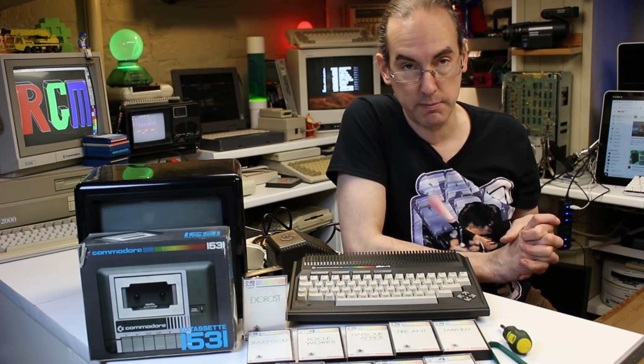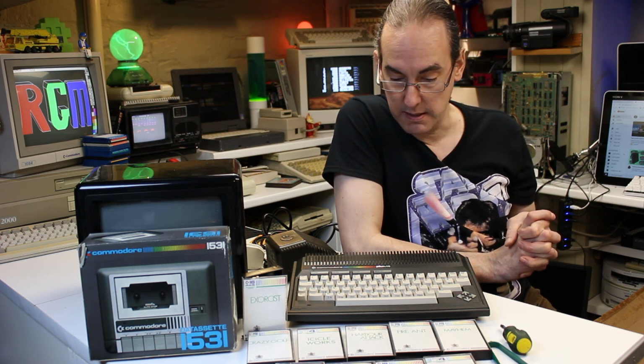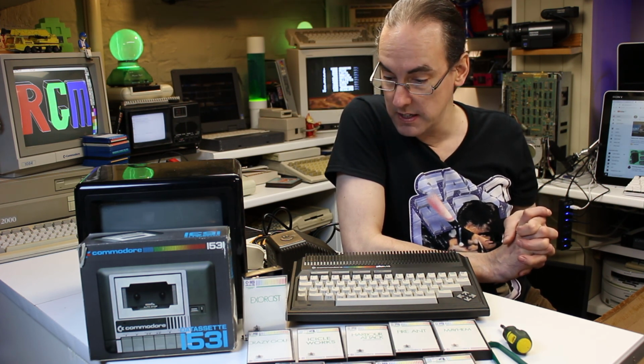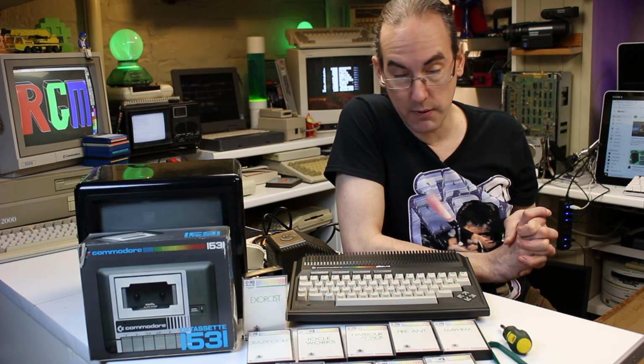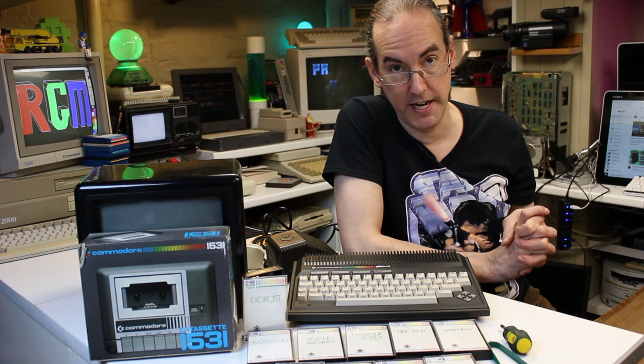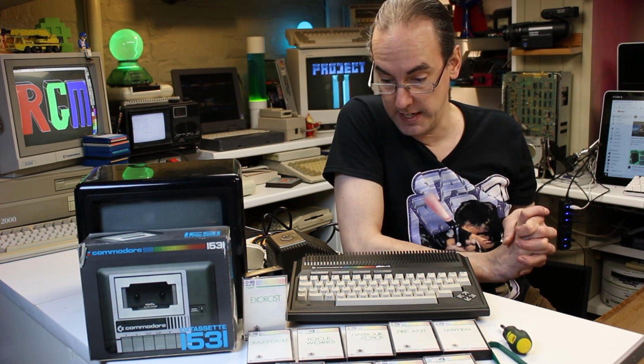I'm going to try getting a new CPU for it first. That seems to be the first thing to try. As I said before, all the other chips are getting warm. There's nothing there that's getting really hot to indicate there's any faults. So hopefully I'll get it going, fingers crossed. And I'll get back to you with a follow-up video with some gameplay hopefully.